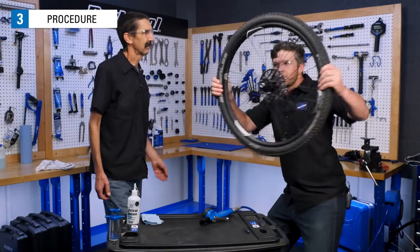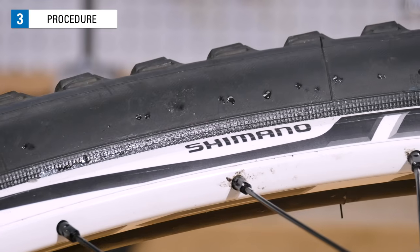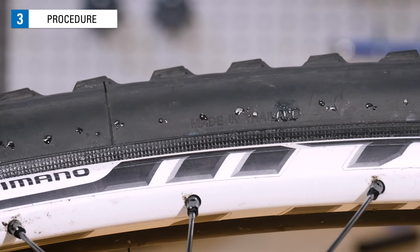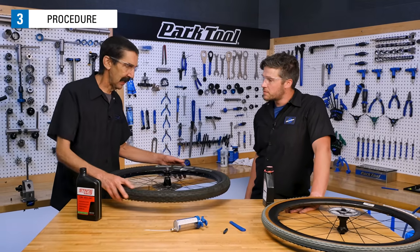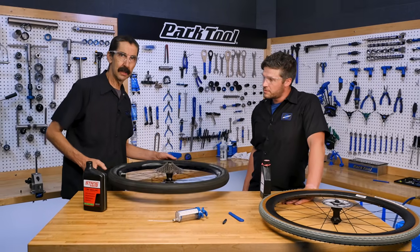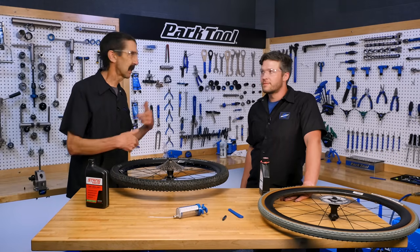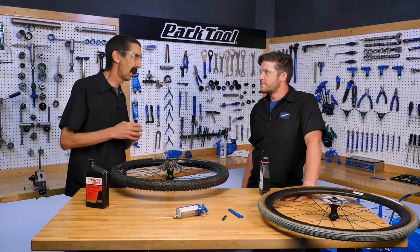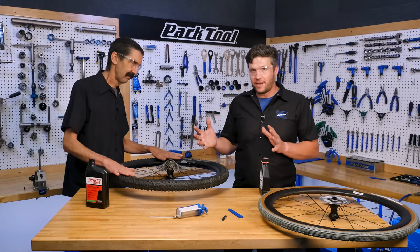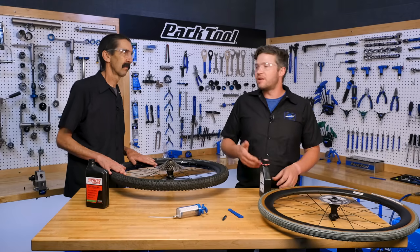Now we shake. Shake the tire and rotate it around to coat the inside of the tire and rim with sealant. You may see small white dots on some tires — that is the sealant filling tiny voids and is considered normal. Another distribution technique is to lay the wheel horizontally, let it sit a few hours, then flip it and let it sit again. One of the best final methods is to actually ride it, as flexing the casing and working it as it spins helps work the sealant into all the pores inside the tire body. Also make sure to check your tire pressure before each ride, especially in the first few weeks of the tire's life, as the setup can lose a little bit of pressure.